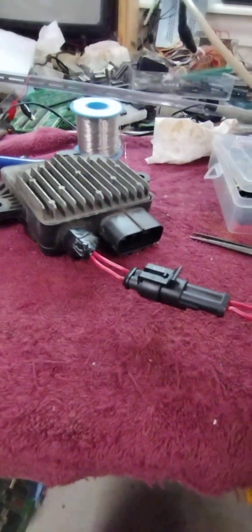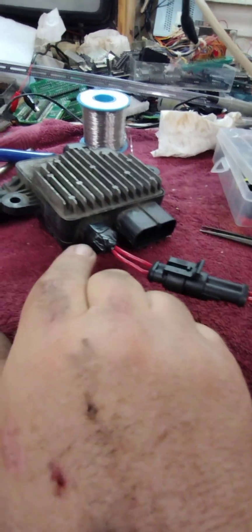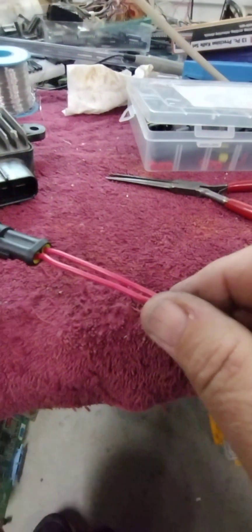This is the last step before I actually install everything. I went ahead and put some black tape around this to seal it up and keep moisture from getting in. It might be better to use epoxy for something more permanent, but I think it's fine. You can see the connector here — this connector is replacing the old broken one. These wires are going to be soldered to what plugged into the original connector; I'll chop it off, strip it, and solder these directly to it.